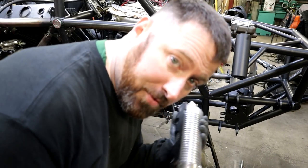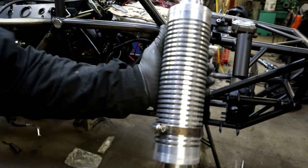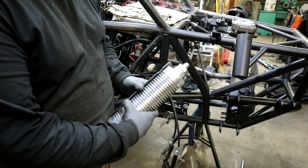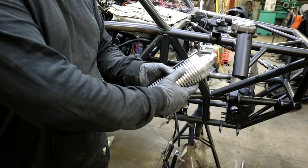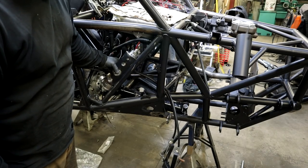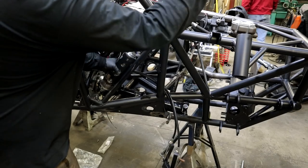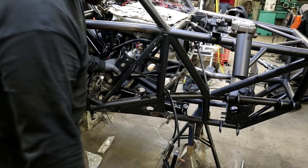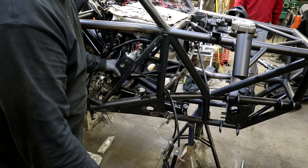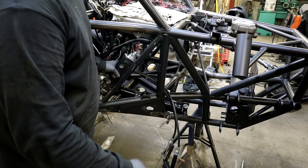Something else we have to remount is the power steering cooler — this cools the hydraulics after it goes through the hydro-boost steering and does the work, so it's a very important component. We're looking at putting it right here because there's airflow coming through and the transmission is pushing air down, so it's going to pull air across it as well. That'll be a decent spot for it. We'll get this tacked up, then figure out where we're putting the pressure relief valve and measure all our plumbing to get the lines made tomorrow.